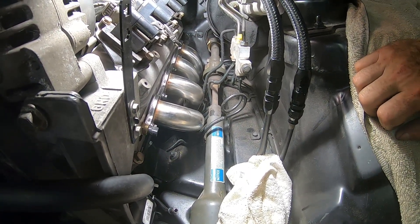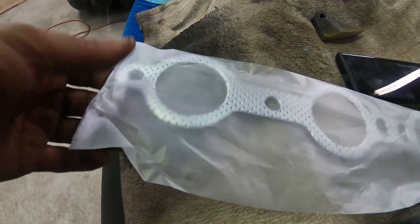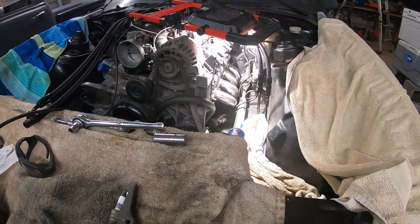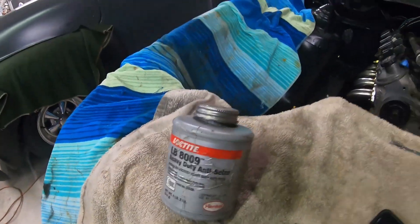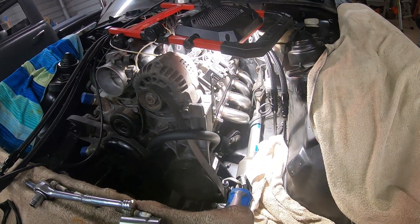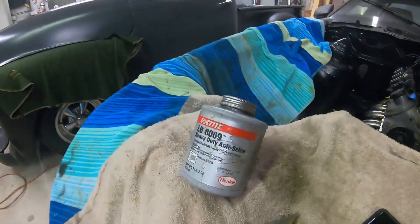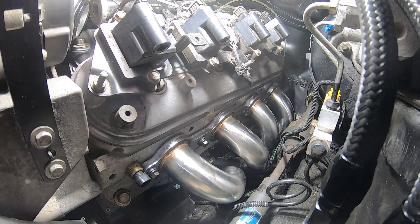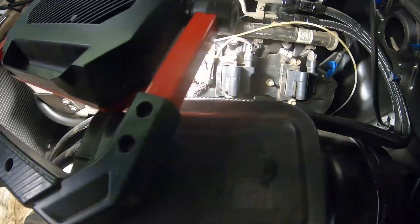On the driver's side I went ahead and put all the bolts in with the gasket that came with it. I do have a multi-layer metal gasket but it's used, so I'll try the included one first — if it blows out I'll replace it. One thing to remember: use some anti-seize on your exhaust header bolts. It'll make it a lot easier to remove later and you won't be snapping studs. Be real liberal with the anti-seize. Also, always go back and re-torque anything that goes through a heat cycle.